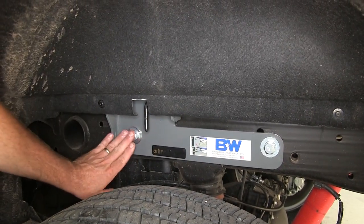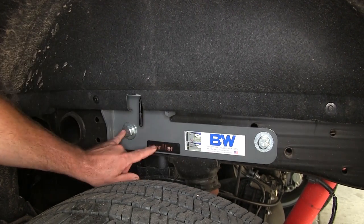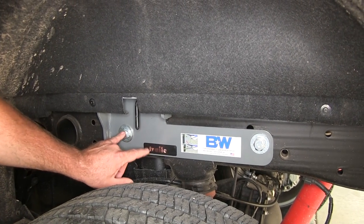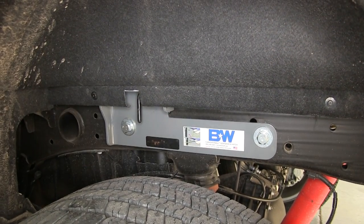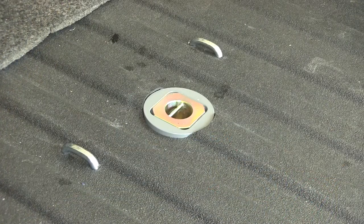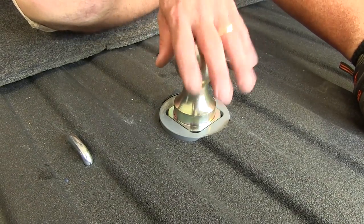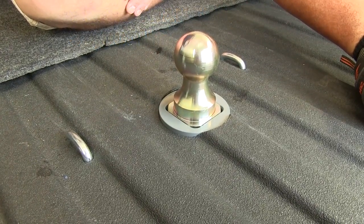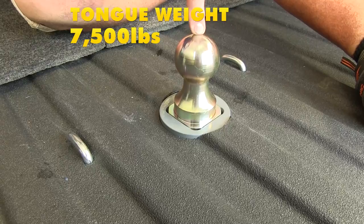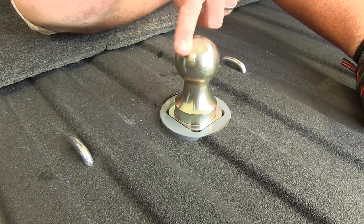Now with the B&W side plate, it's going to use factory weld nuts to attach, so there's going to be no drilling or having to fish any wires or nuts inside our frame — it's just going to bolt onto the side of the frame rail. The only holes you're going to have to drill is the four-inch hole for the center and four half-inch holes for our safety chains. This gooseneck hitch is designed for 30,000 pounds of gross trailer weight and a 7,500 pound vertical load limit on the ball. It's a 2 and 5/16ths ball.